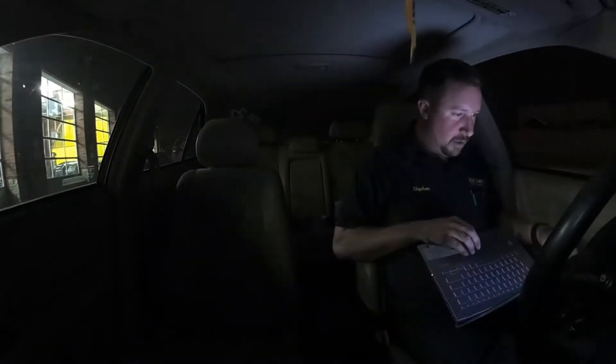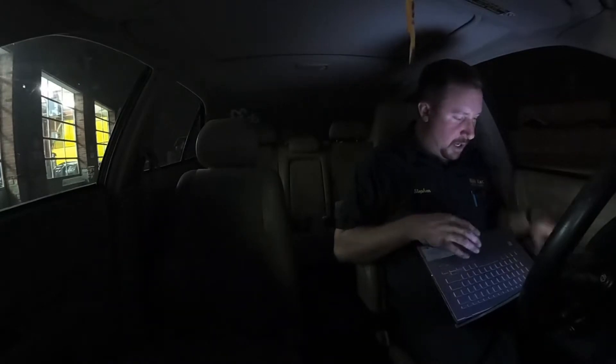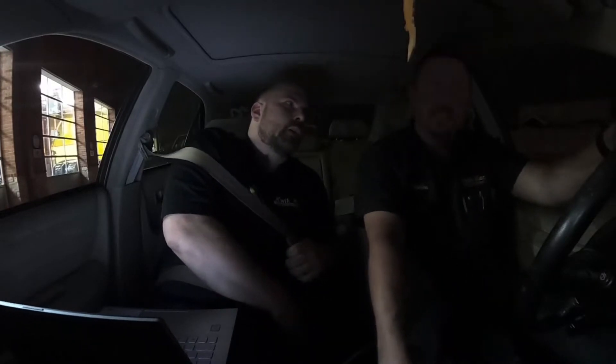We're online for the test drive. Back to first — just push it forward and it locks. Knock input is up on the Mega Squirt. We notice the wideband was disconnected, but we're not going to run much boost anyway so it should be close to last time. Running some light boost — no knock detected. The shifter feels much better going back and forth this way.